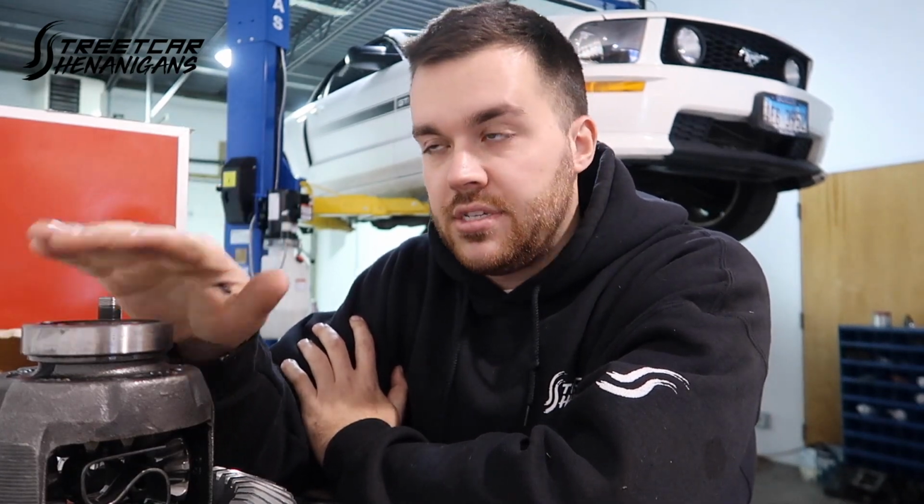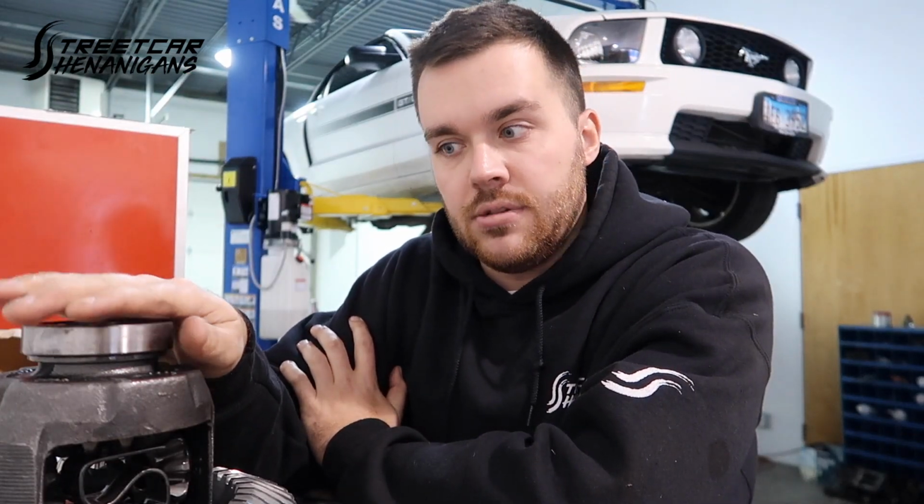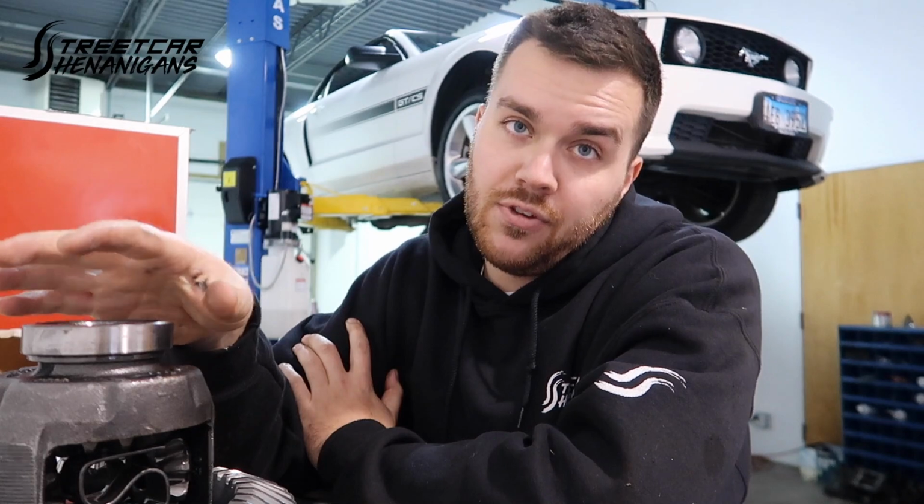Then I talked to Ford Racing and said, hey, I put in a used gear, I know it's not going to be perfect, but I don't think it should howl as loud as it does on decel. And the first guy said, well, maybe take like 3-4 thousandths out of the pinion depth. Maybe that'll fix it.